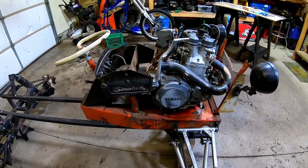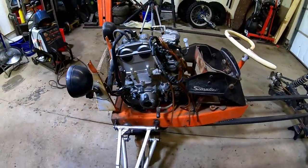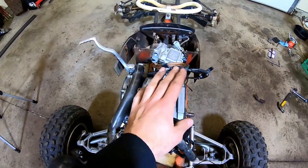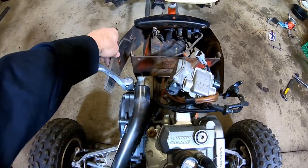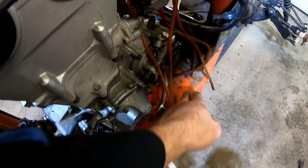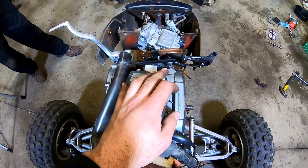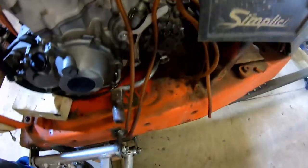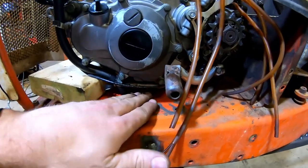We have the motor sitting in place, lining up the head with the center of the tractor, which actually works out good because it puts our kickstarter to the outside. We're going to obviously have to modify this sheet metal a little, but this lines up our sprocket inside here a bit and we're going to cut a hole down here to run the chain down through. It's looking good — the next step is we're going to work on the engine mounts, with a little engine mount back here and one down below.